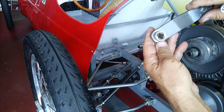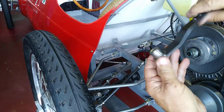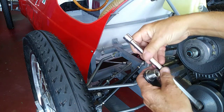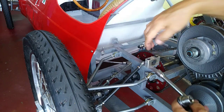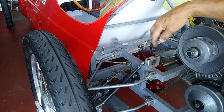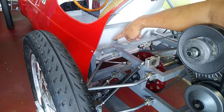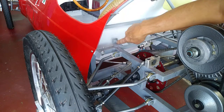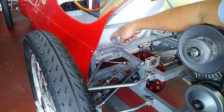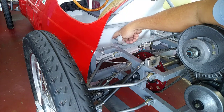That's just a 16 millimeter - you can go any size you want, it really doesn't matter as long as the hole corresponds. This is an unmodified Craftsman 10-inch 3/8 drive ratchet extension, an aluminum block with a corresponding hole to the socket - a couple thousandths clearance probably - and then on this end there's a one-inch ratchet extension done the same way. The bracket is welded into the frame, the socket extension is put through, a 3/8 slug is inserted in the hole in the extension to give more material to weld to, and it's all welded solid on the back side.